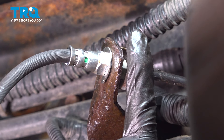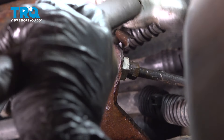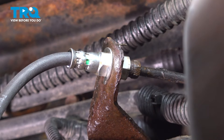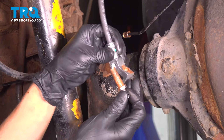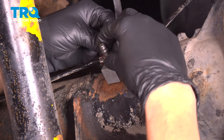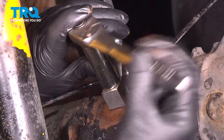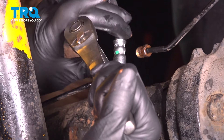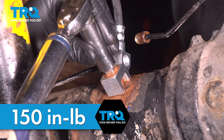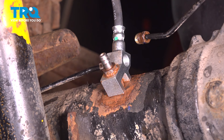Take this clip, line it up with the cutout, and use a little hammer to tap it in. That's locked in. I've grabbed the brake hose and put a little bit of anti-seize on the bottom of it. Stick this bolt through for the breather, cleaned it up, put this on and start it by hand. The torque for this is 150 inch-pounds, which converts to 12.5 foot-pounds — it's very low. The bolt is hollow, so over-tightening it can result in it breaking.